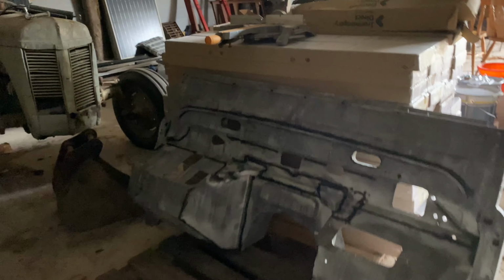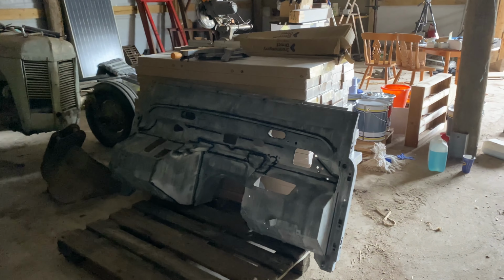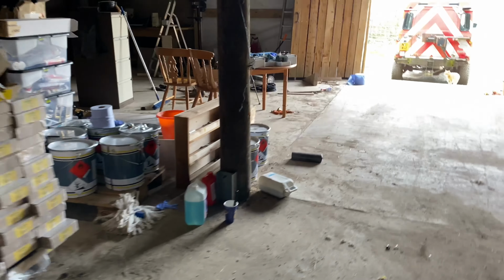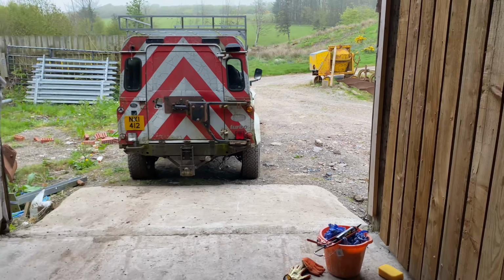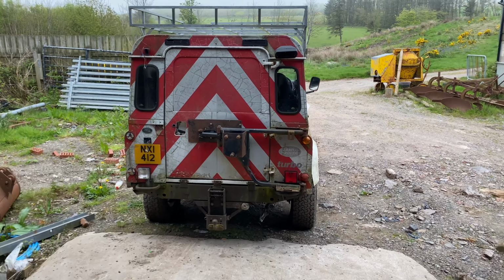Today's Sunday. It's about 5 o'clock on Sunday. So I'm going to let all that seam sealer dry all week, cure, and then we're going to etch prime it. I've ordered 6 rattle cans of etch primer, and I'm going to etch prime it and probably do Raptor paint or bitumen on the footwells and everything that's going to get the hammer.